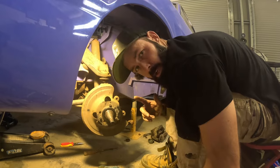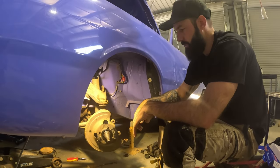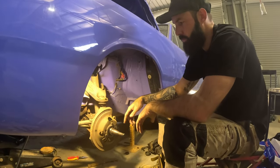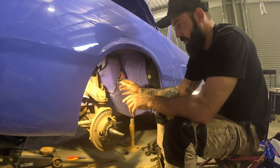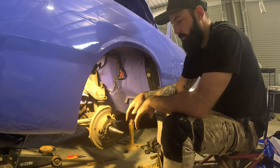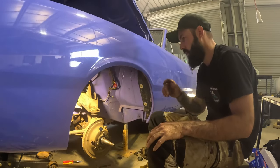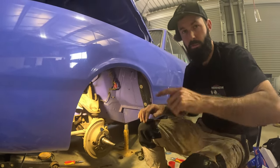I forgot to mention — I'm taking off the spindle hub housing. The upper and lower ball joints — I'm taking those ball joints off, but I forgot to say that it's going to be under torsion suspension, so it's trying to push it down and we've got everything trying to lift up. If you don't jack up the front under the torsion rod and you've got torsion suspension at the front, it's going to be always fighting against it. So we'll get that jack, pop it under there, jack it up, then I'll get a rattle gun and undo the torsion suspension all the way down.